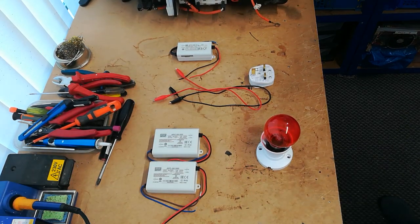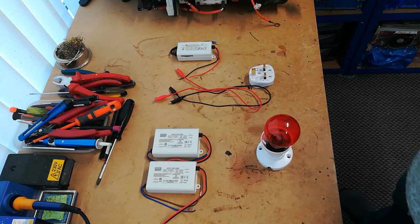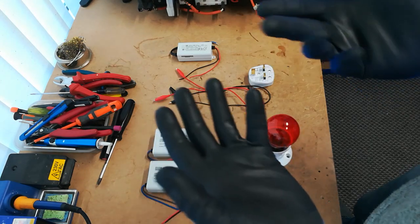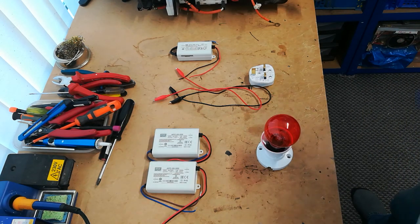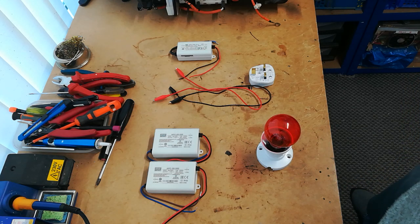This is for UK owners who have got their cars laid up in lockdown, to show you how to make the most basic charger and discharger setup. There are a few basic things you need to be very careful of — obviously it's high voltage inside, so you've got to be careful. First thing you need is a pair of rubber gloves; if you're fiddling around it's always good practice to have these on. Make sure the IMA battery main switch is in the off position.